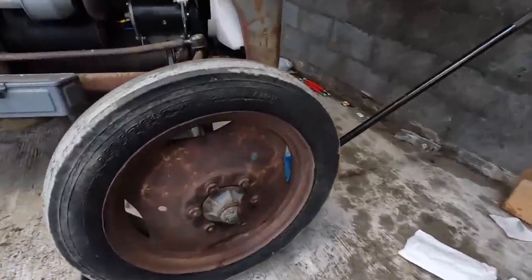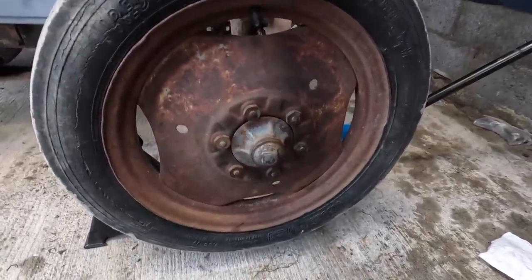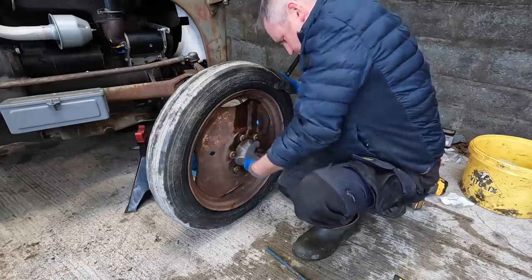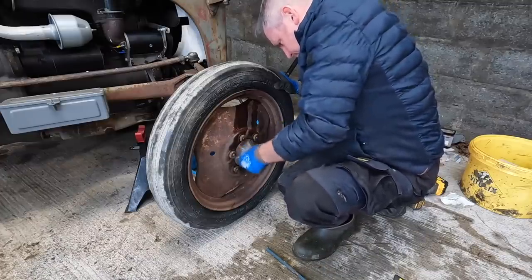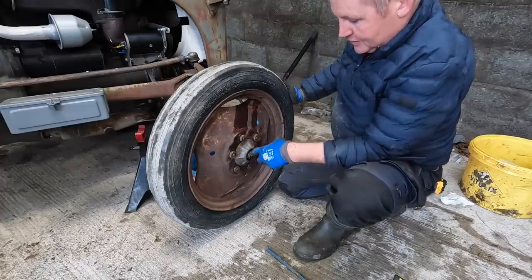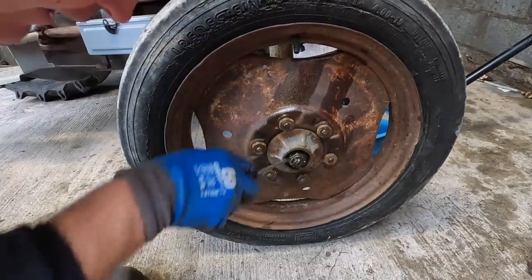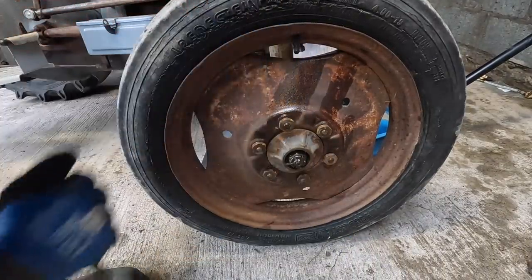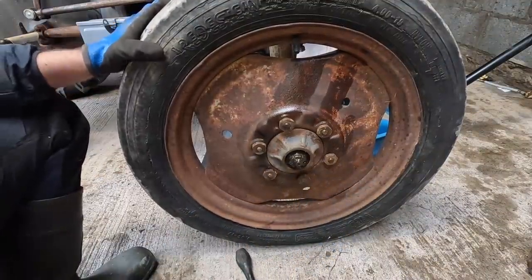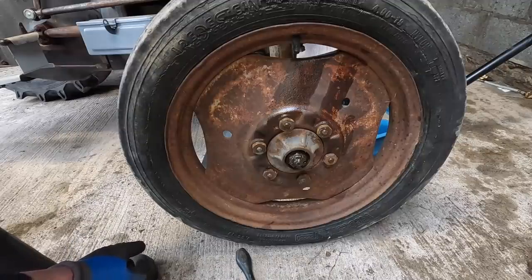The next thing we're going to move on to is the front wheels. I'm shaking this - there's a little bit of movement in it but it's not massive. I'll just take this off first. I have new ones that have grease nipples, which I find are far better to get the grease packed in around these. Next thing we're looking for is a split key. I'm going to straighten that out - it looks to me that it came out too easy. I wonder if the hub is just loose. I'm going to jack it up a little bit and try to tighten it and see if that fixes it.